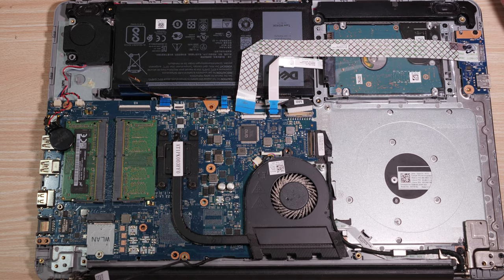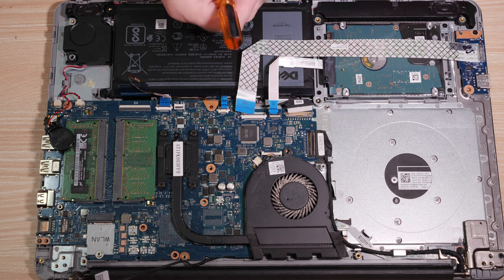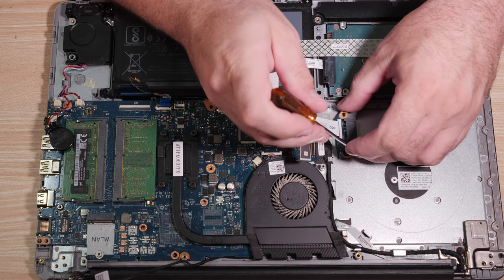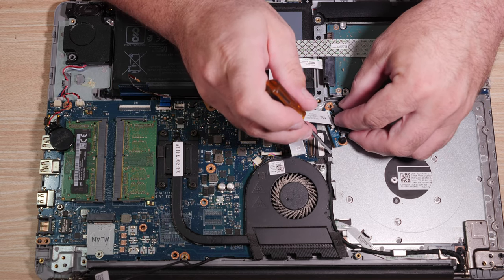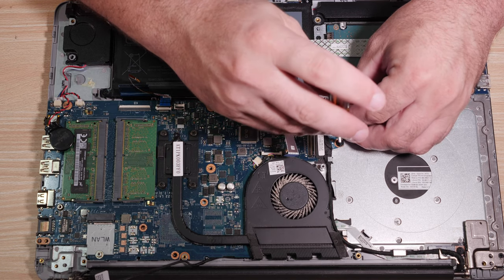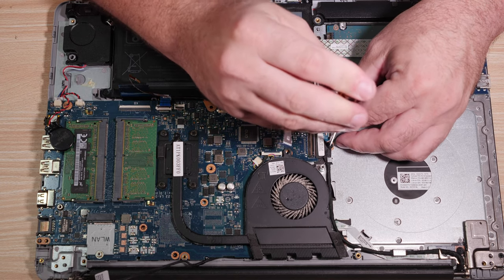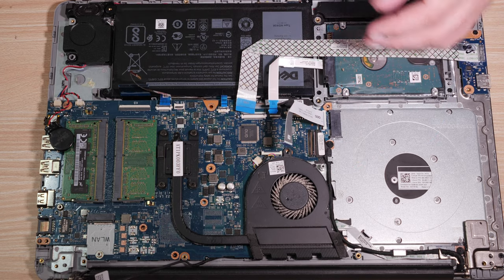I'm trying to see if there's a difference there. There is not a difference. Let's go ahead and get this flat screw on this optical drive board. And I think maybe we'll use this stud sticking up and put the screwdriver on the screw to retain it, pivot it in place under the display cable, screw it down. That's that, and we're done with that, I hope.